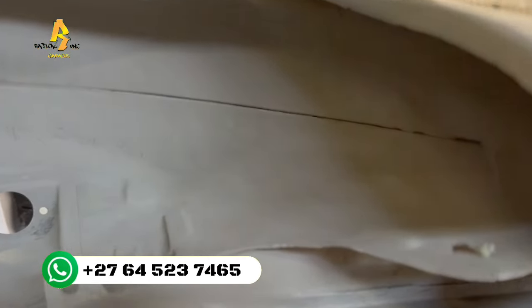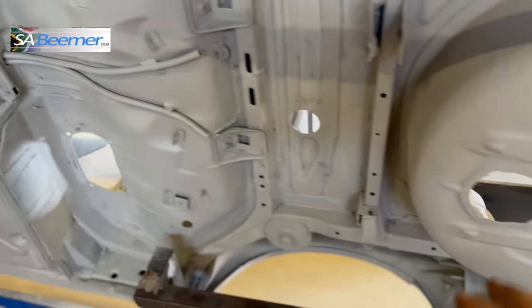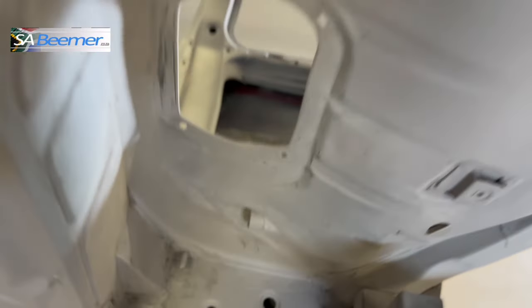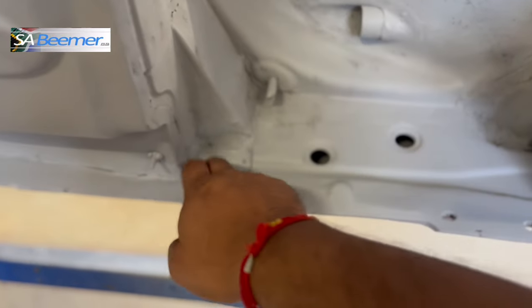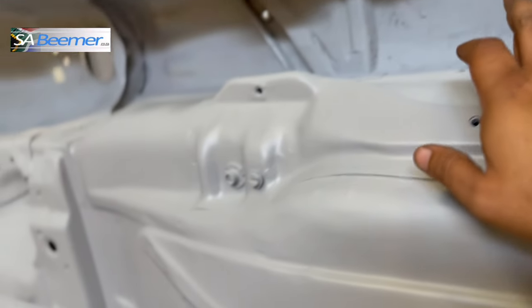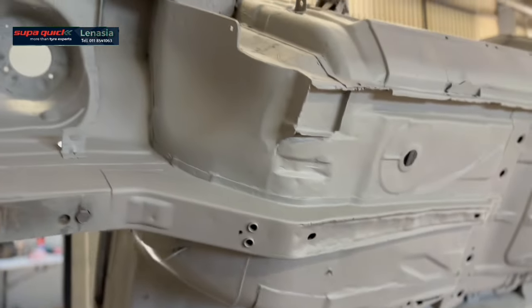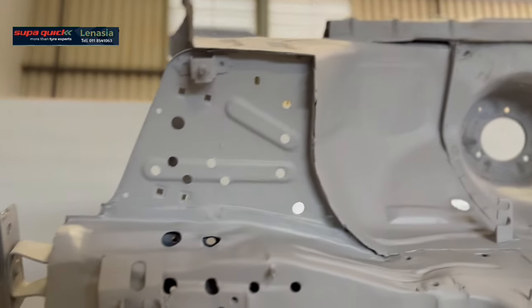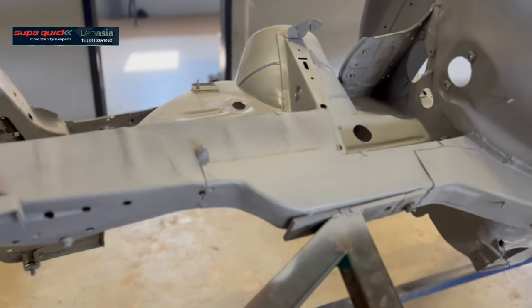You can see here these are your arches - this is how far we've gone into the arches. We haven't pulled every single panel off the car but we've pulled a lot of panels off and tried to clean up as much as possible. In this area I'd still like the guys to clean up the extras here. The tunnel looks decent, that's clean, the floorboards look good. There's an area there that needs to be cleaned out. Under your towers there are handprints - we've got to flat it down properly and get it cleaned off before she even thinks of getting into the paint room.